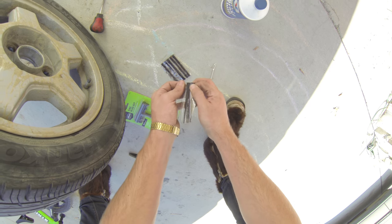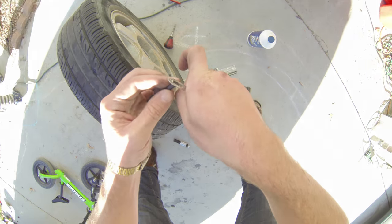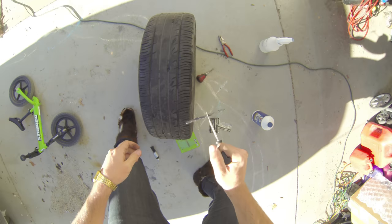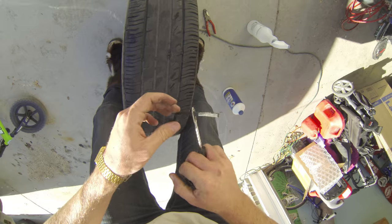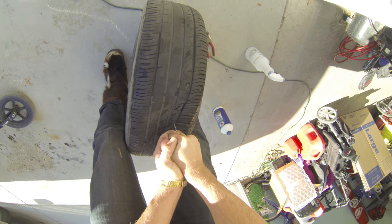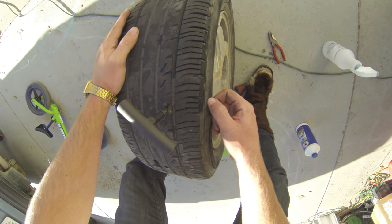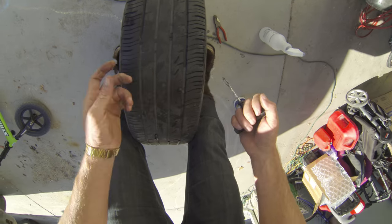Take your patch and just put it through the hole — thread it. This thing is hot from friction. Thread it through so the plug is right in the middle. Push the whole rubber plug in there. At the end of this tool there's a little opening — when you pull it out it releases the plug. Push it in, try not to go too far. Then one quick motion, pull it out — it'll pop through, and now it's pretty much sealed.